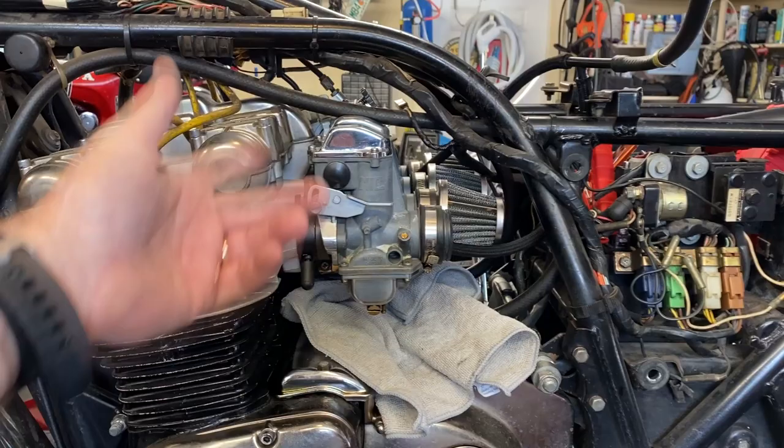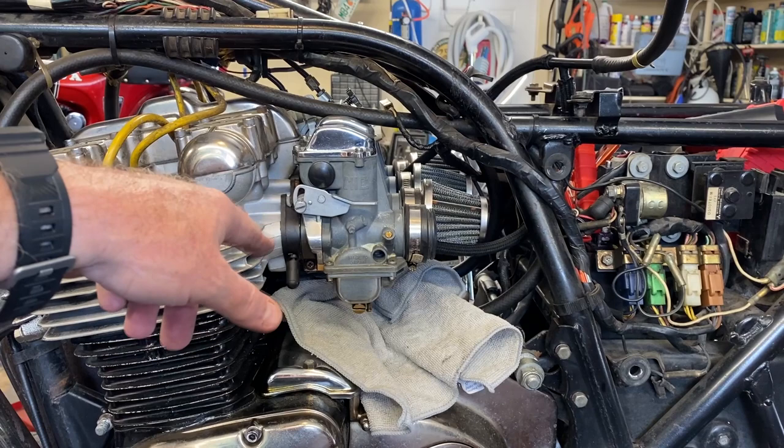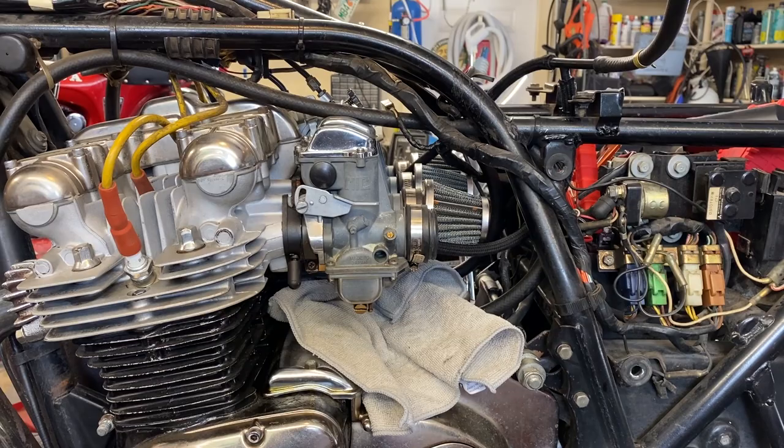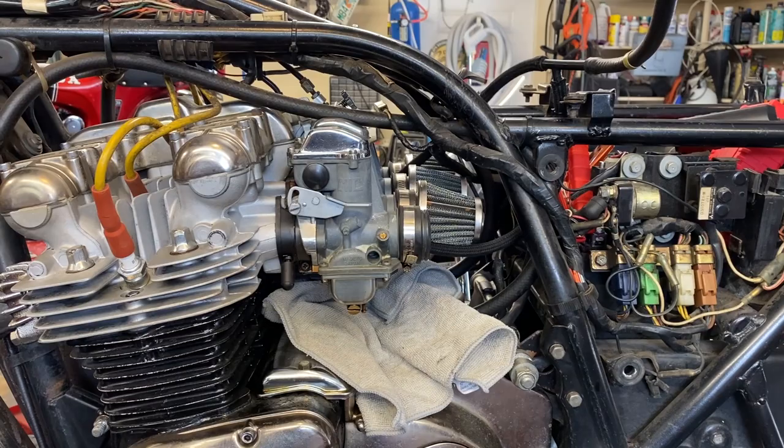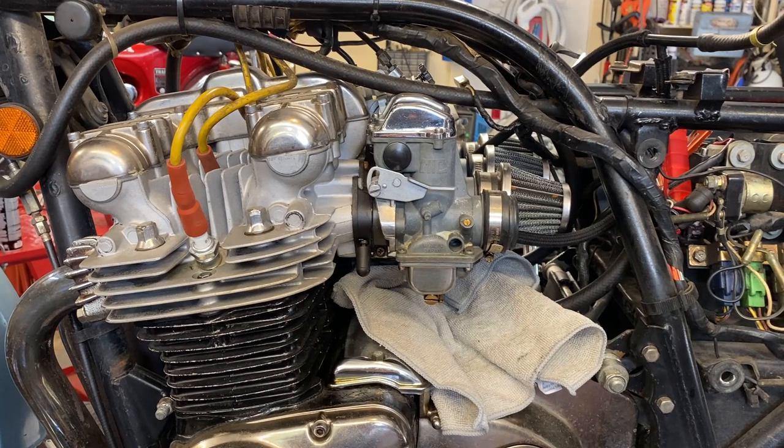I'm gonna go ahead and pull the carb rack. I'm gonna have to do it anyway. We know it runs, but we know it smokes, so what the hell, we don't need to leave those on. I always like to do a compression and a leak down test with the carbs off so I can put my head up right against the intakes, or my ear rather, when I'm doing a leak down. And there's no restriction on a compression test with the carbs off, just completely none. It's way better than even with the throttle open. So it gives me a little bit more of an accurate measurement, because if we do some top end work we'll retest it the same way, and we'll see the improvement there.